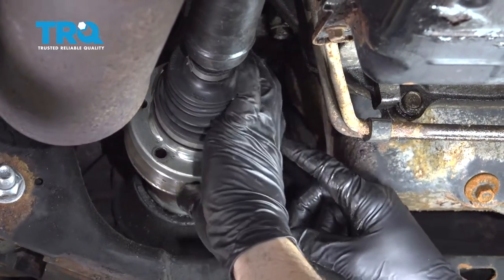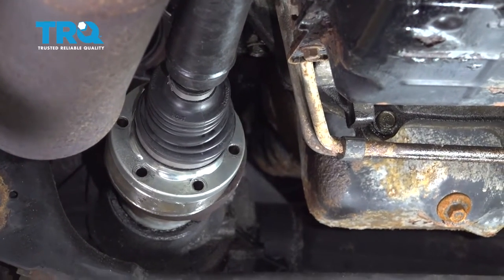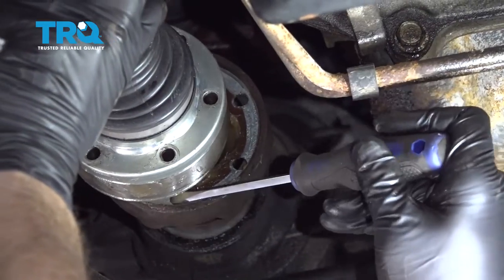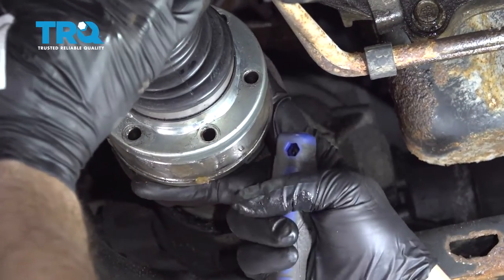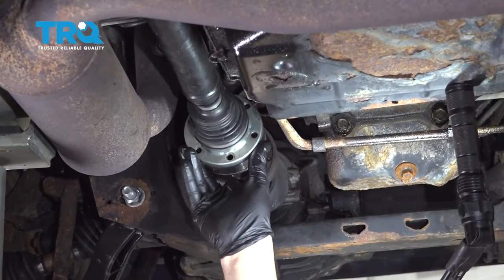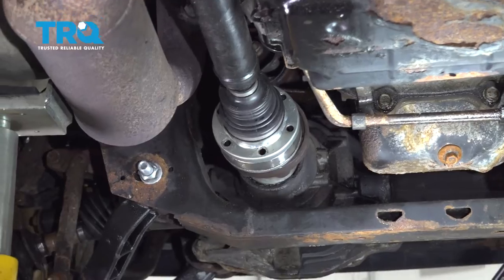The interior cap for this drive shaft did pop off — it's in the front part of the drive shaft yoke. We're going to use a screwdriver just to reach in there and pull that back out. With this unit compressed as much as we can get it, it does have a lot of play. We're now going to move to the back section and loosen that one.